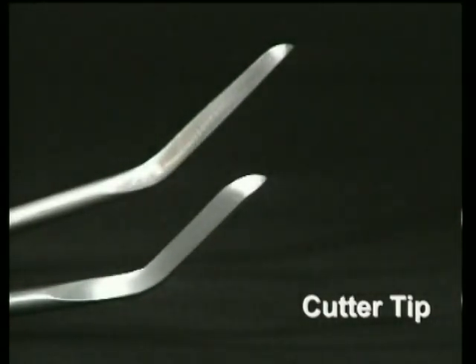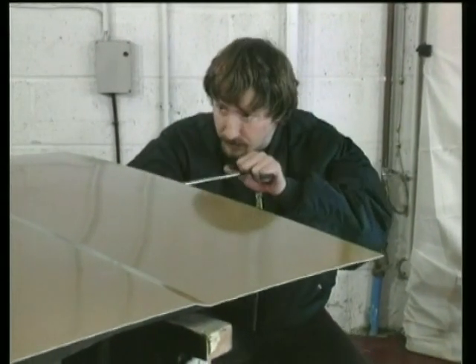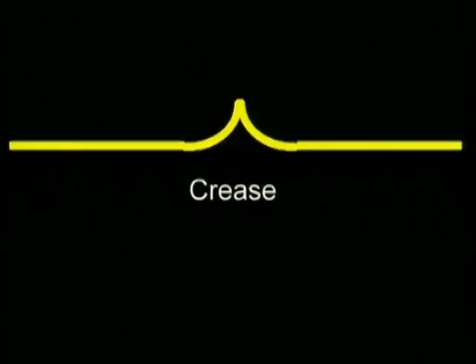The cutter tips have a bend and form a long wedge shape at the end. They have a sharp edge. These tips are good for removing tiny dents called micro lows because of the point that they have. One of the best features of the cutter tip is that it tends to grip the metal, so once in the right spot it doesn't move. Excess force must not be applied, otherwise there is a danger of creasing the metal. This is about the worst damage you can cause to the metal, so please take great care.